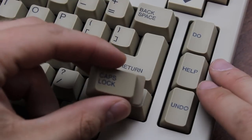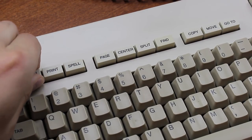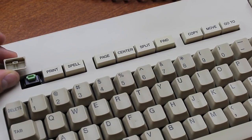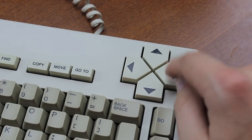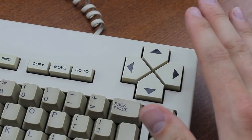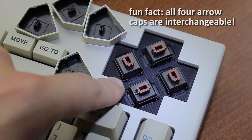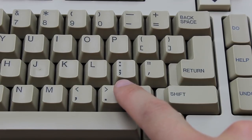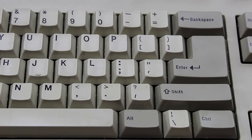These three keys on the right are 1.33-unit vertical keys, which I'm quite sure I've never seen before on anything. These caps, as well as the Caps Lock key, all use blue lettering instead of black. The buttons at the top are not just much shorter than normal caps, they additionally don't use Alps mount — these keys use Alps SKCL compact switches, which use a thinner but longer bar mount, making them two-way incompatible with standard Alps mount caps. There's also a giant D-pad-like nav cluster at the top comprised of humongous arrow keys, and the switches are actually rotated 45 degrees. The D-pad even has rubber landing pads for the caps. Additionally, the special keys have the lettering in all-caps, which is pretty rare. One detail I couldn't help noticing is the semicolon key, which has disproportionately fat symbols — compare it to the quotation mark next to it.